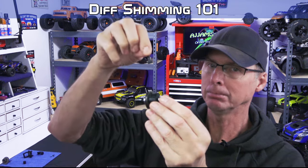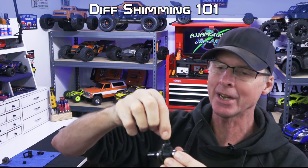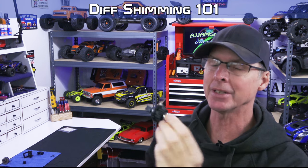That's when this one comes into play, and you can adjust it down a little bit to engage the teeth more. Blink, just like that. If you have to adjust it all the way down till it hits the housing, you've got problems, and they're not easily solvable, because the way this is designed and the way this sits in there dictates where you're going to put your shims. So try shimming this first, because that's what they recommend.